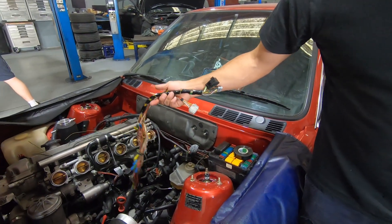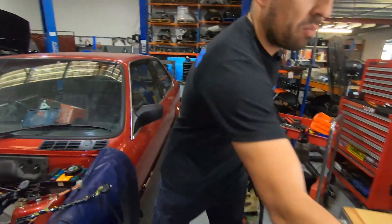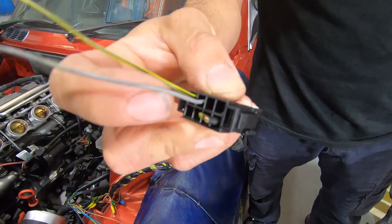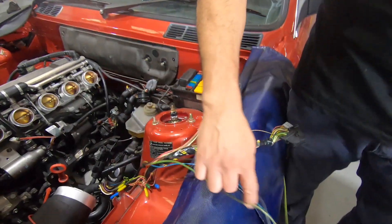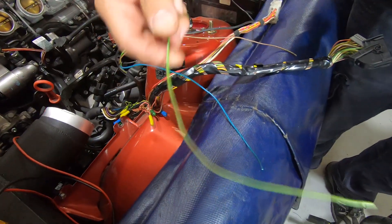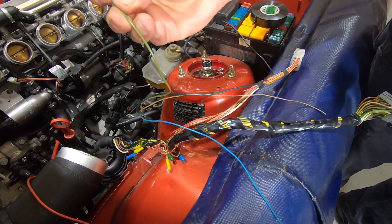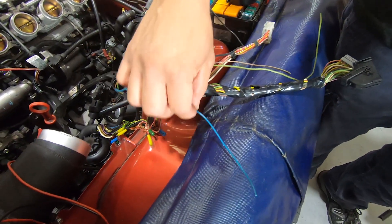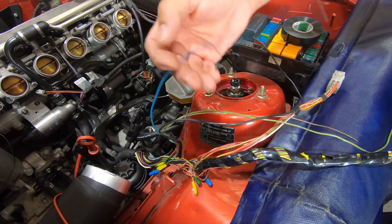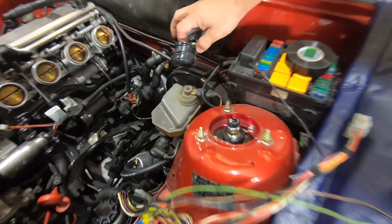This is the loom that attaches to the engine. I did start already — I got rid of this little guy here. There are four wires: there are two that I've cut and these two that are not needed. We have our starter motor start signal. We have this one here — it's an ignition 12 volts, it's a voltage reference for the alternator. This is our alternator light in the dash, so that needs to be hooked up to the blue wire in here that goes to the dash as well.